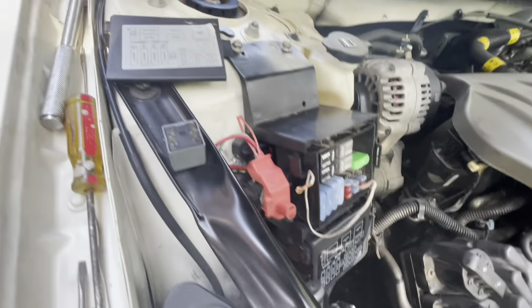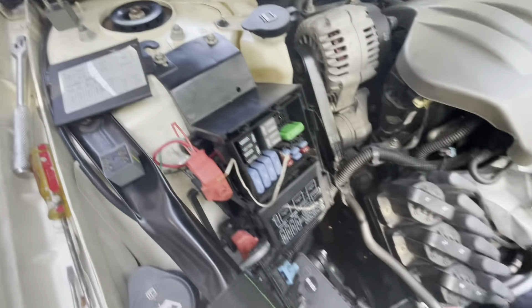Let me show you how it works. That's pin 86 — I'm going to put the positive lead on pin 86. You heard it? So I'm throwing a positive into pin 86 to bring a positive back to the computer so it recognizes the start signal. It just cuts power otherwise. Let's go to the key switch now — off, on, crank. Right up guys!